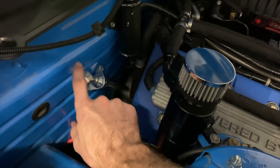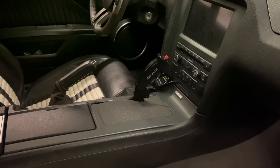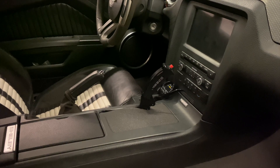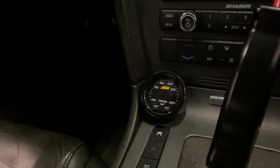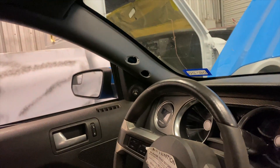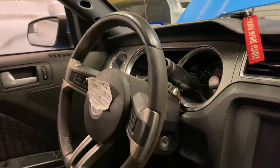The last thing under here is — you'll notice it has a dipstick now — we did a TH400 setup. JPC sent us over a setup. I believe it's a Stage 3, so it has all the upgraded internals — I think it's the 1,300 or 1,400 horsepower rated setup. We also did the AEM trans temp gauge, and it worked out nicely mounting it right there — it's visible and doesn't go on the A-pillar anymore so it doesn't look tacky. We also added a little shift light.